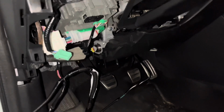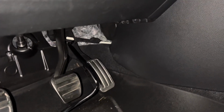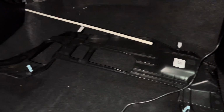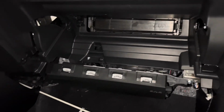After I verified the light was working properly, I unplugged the sill and started running the wiring harness over to the passenger side. I used a wire fish line to attach the wiring harness wire to and help run the wire through the middle section of the dash. To hide these wires, you'll want to remove the bottom section of the dash underneath the glove box. This trim piece can be pulled down, then out from the dash. There are no screws holding the piece in place. You do not need to remove the glove box.